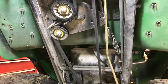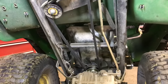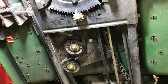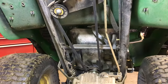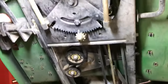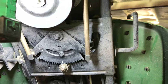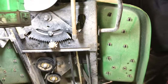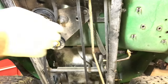I have this up in the air — this is how I do it at my shop. Just be real careful if you're going to jack this thing up. If you're going to put it up on jack stands, just be real careful. I'm using a one-ton winch, but I've been doing it for a long time. Just be careful getting underneath this thing. I'm going to push the clutch pedal in, which releases all the tension. You put the brake on and lock it in — now that belt should be extremely loose, and it is.